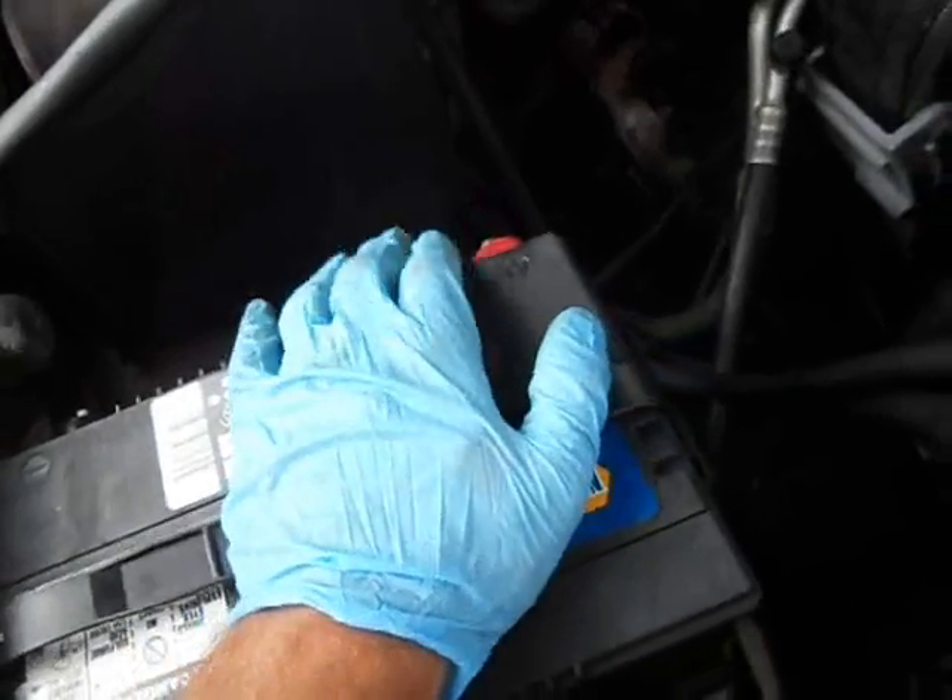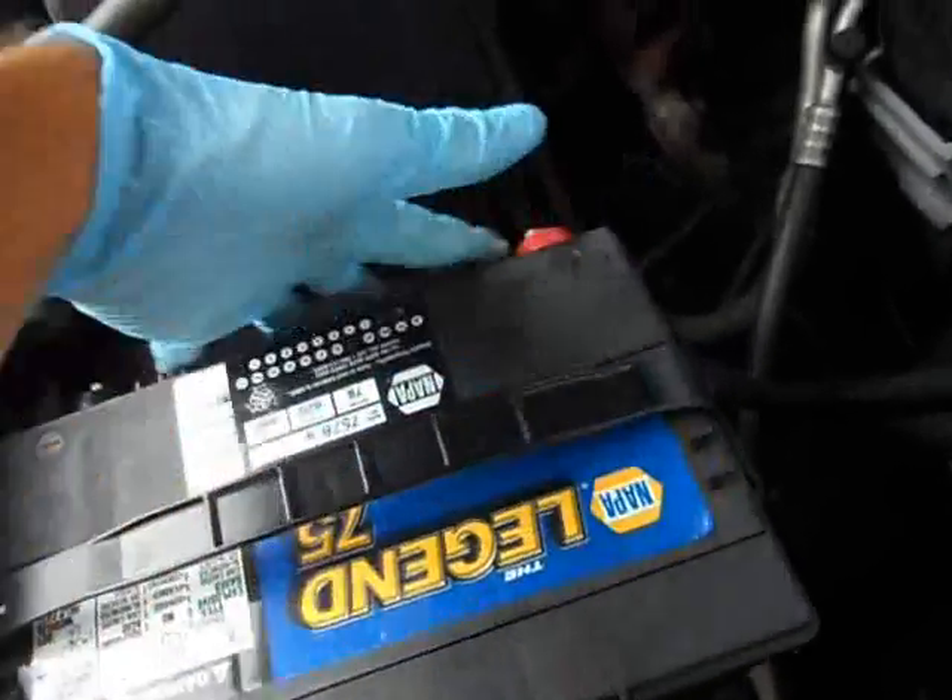We're snugging them up — that's how they should look when they're tight. Clean that too, the battery cable — looks like brand new almost. A little dirt over there and my fusible links coming off of it. That looks good. Hopefully that will allow it to be charged easier, cause I don't drive this thing a lot.